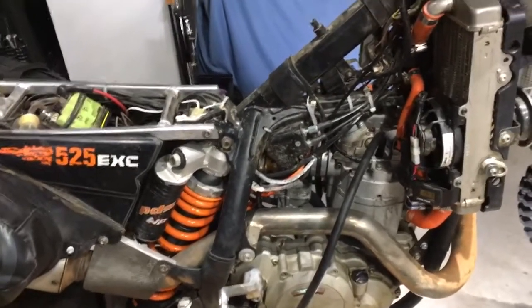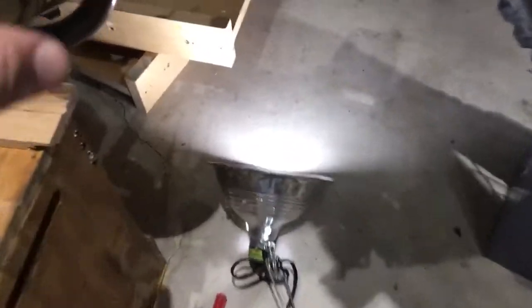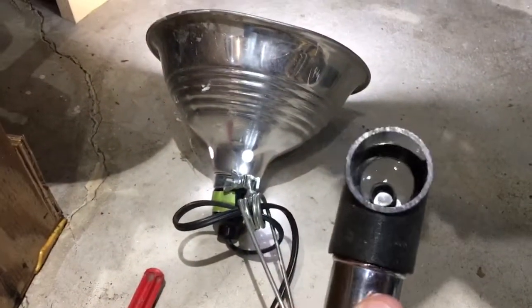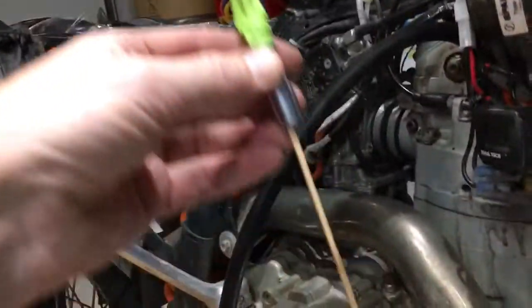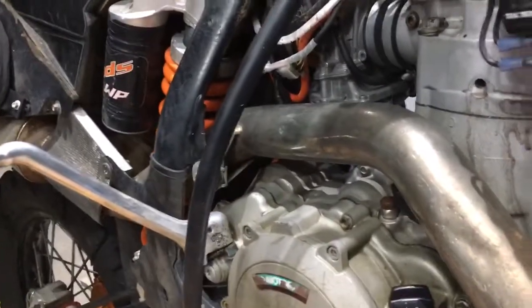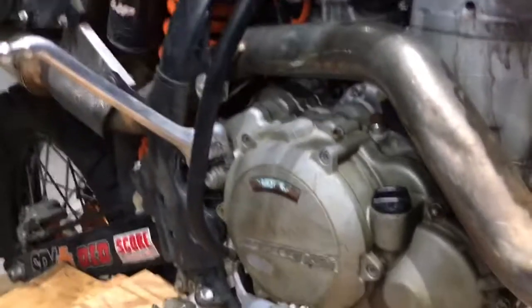I thought I could do this in a minute but no way. I was turning the rear tire in sixth gear, going back and forth to the front looking for the notch in the flywheel using an old spark plug inspector with a lamp on it - really tedious. Finally I found I could continuously look at the flywheel and reach back to pull on the tire. I also used this weighted whittled-down chopstick to ride on top of the piston, though it gets a bit bent because of the valves opening and closing. That's it, thanks for watching.